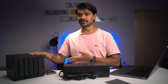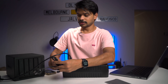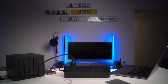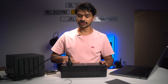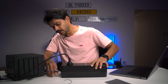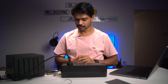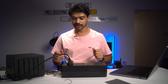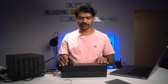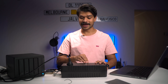The Synology NAS has turned itself down safely and completely. Let's plug this in — just plug the UPS into the mains. So now I have plugged the Synology NAS into the UPS and the UPS into the mains. I'm going to connect the USB cable first. Here we have the USB cable — one end in here, the other end at the back of the NAS. I just realized I plugged the Synology NAS into just the surge outlet, not the battery-plus-surge outlet. So it's time to shut it down once more and plug the cord into the battery-plus-surge outlet.